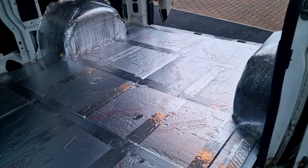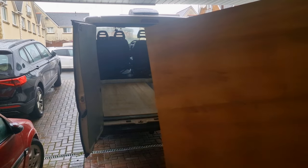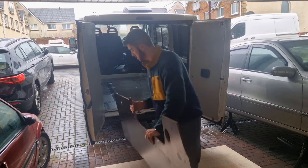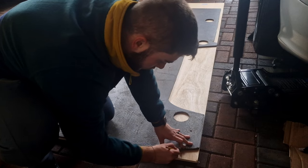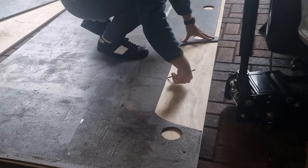After the insulation was in, we used foil tape to seal up all the edges as well as the wheel arches, the side vents of the van, and where the bulkhead used to be. So now it's a complete vapor barrier and no moisture can get through the wood or through the insulation. We were chuffed with how it turned out. It was then on to securing our plywood down - we bought two sheets of 12mm plywood and traced around the old van floor to get the shapes right. Really straightforward and we got it done within a few hours.